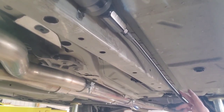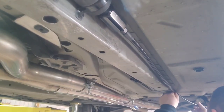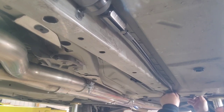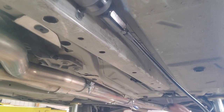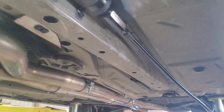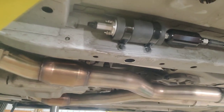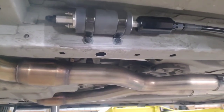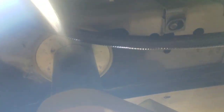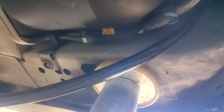Here's this line that's running from where I showed you coming off the top of the tank. It does not seem too excessively long, so I can take the little excess out with the little bend here in the back where the factory bends, and it looks like it's going to be good to go — I won't have to move anything. Now I just have to run the front line. It's almost a 180-degree turn and that's going to come back along with this one, and then it's going to tee right up here. There's a T fitting that goes here where the other one goes — it's a 90-degree fitting — and then actually all that's left is just the plugs.